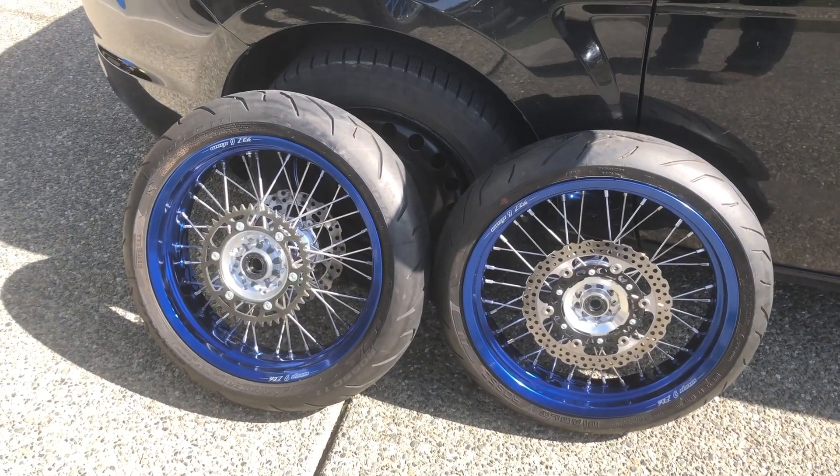For the front, we need to remove this nut here. There are two 10mm bolts to remove — two on each side — and then two 12mm bolts for the calipers that we'll need to move around. You just have to loosen these off; you don't have to take them all the way out. Again, you've got spacers on the front here which we'll use in the new wheel. Remove these two bolts because we've got to move the caliper.